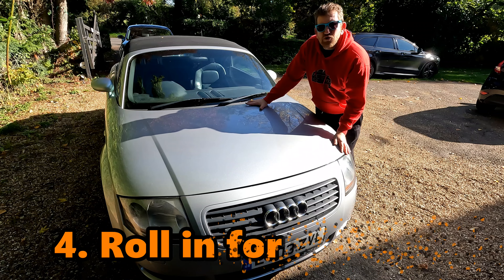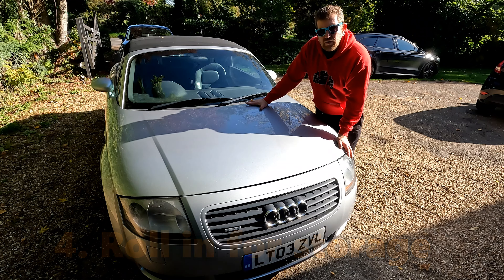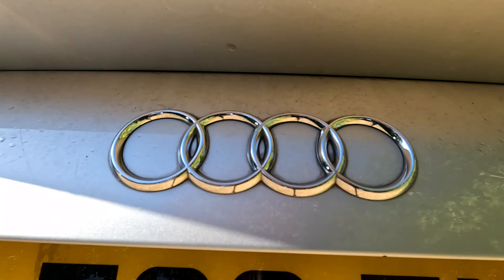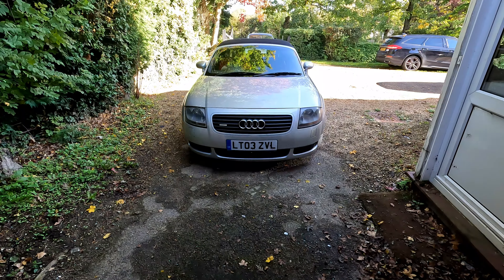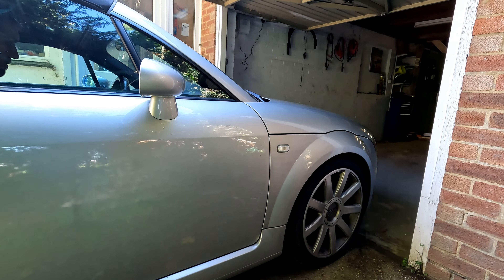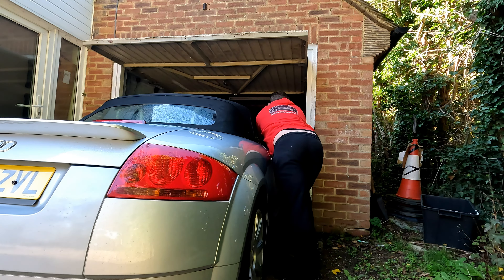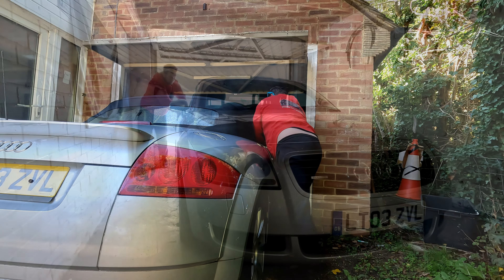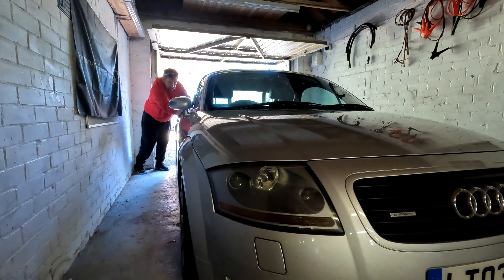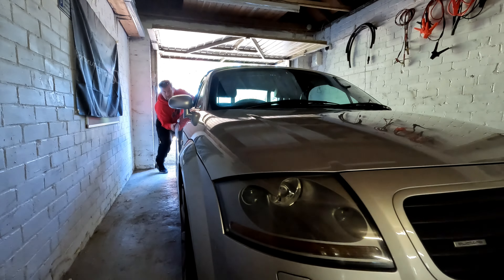Now for the actual storage, I'm going to drive this up to the edge of the garage. Once I get it there I'm actually going to roll the car into position and not use the brakes — reasons for this will become clear. Get someone to help steer the car while you roll it in, or get them to help push. The reason I am rolling it into position and not applying the brakes or the handbrake is I don't want to put the car to bed with the brakes engaged. Pads, discs and calipers have a habit of seizing when left on and stationary for a period of time, so I'm leaving them off.